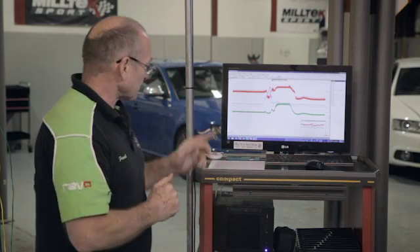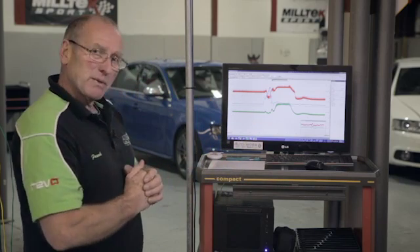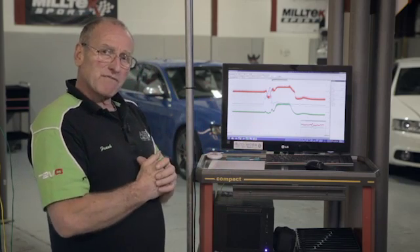The other way you do this is on the road dynamically. Take your scan tool, look at AFR, look at request and actual, specified load, look at lambda specified and actual, and look at your tables. But we're doing it with a scope because we want to look for discrete errors in fueling efficiency — perhaps predicting if there's a problem with injectors before we take them out and put them in a flow bench. This is the predictive part.